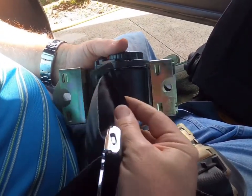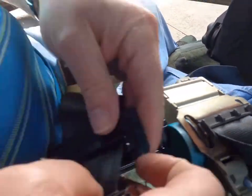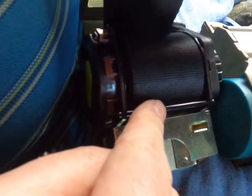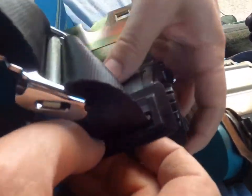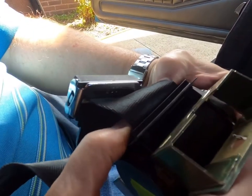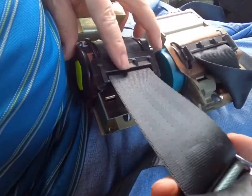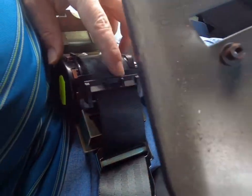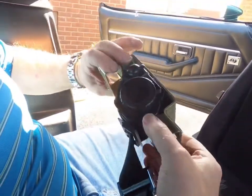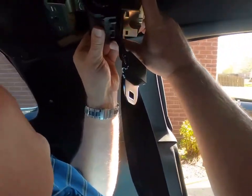I think we figured out what this little guide is supposed to do — they didn't give you any instructions, but I'm looking at how the old one was put together. It looks like you'd want it oriented the same way. It's got a clip here and a clip here, and then we have this little bar right here. So we're just going to come in and clip that onto the bar like that. And then we've got our guide — it's just like the factory one. It fits a little different, but the idea is when you put this piece of trim over it, that's going to hold it in place. So let's go ahead and get this bolted up, keeping in mind the orientation front towards the vehicle — we're going to mount it in just like that.